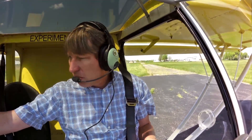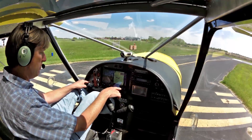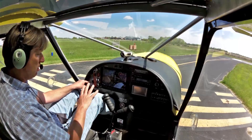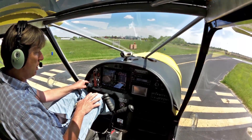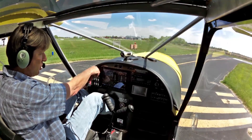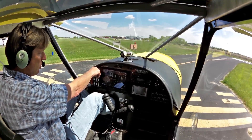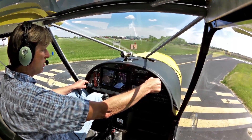The bubble doors are really nice, very solid, very rigid. You can taxi with the doors up. Today is just a little cooler so we didn't taxi with the doors up. Alright, so we're going to run it up. We're going to run it up to 1700 and hold our brakes. Right there is 1700. We're going to go to the right, check our magnetos, see how much it's dropping. Back to both, then left. It's dropping about 15 to 20 RPMs. Back to both and then we're going to check our carb heat — carb heat's dropping a little bit, then back in.